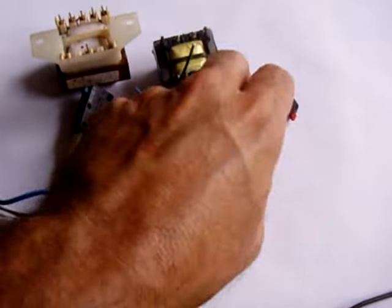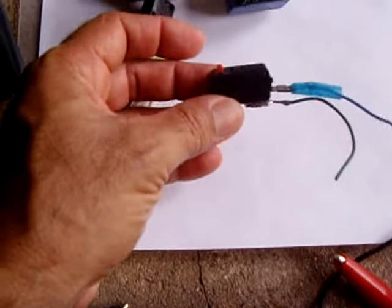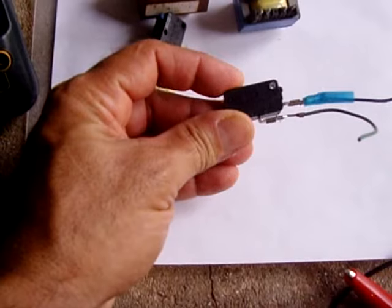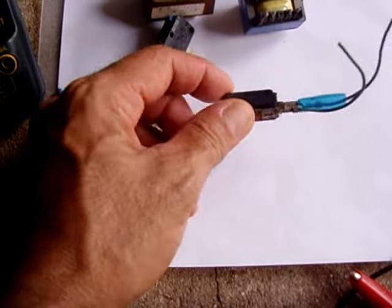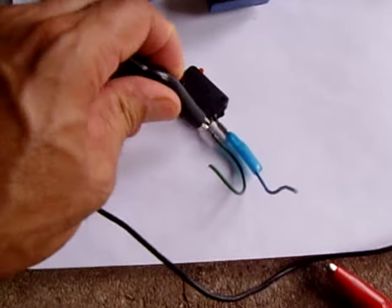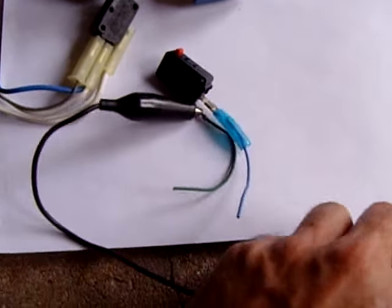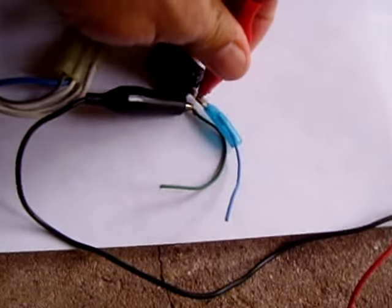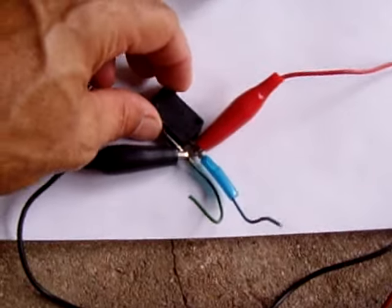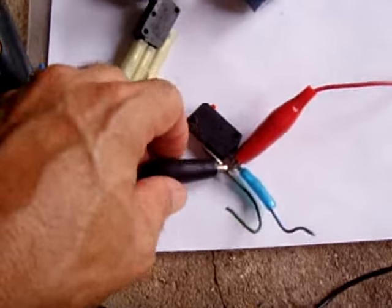Now there are also micro switches or cherry switches. This particular switch has two blades — when the switch is pushed in, the circuit closes; when it's out, the circuit's off. Disconnect one wire off the switch, then put your DMM on a continuity setting on one blade and take the other connector terminal on that blade. Just push it and make sure it works. If it works fine a few times, that switch is good.